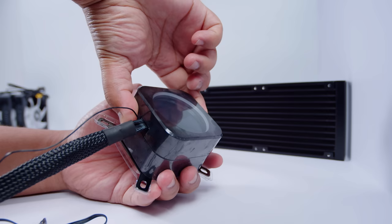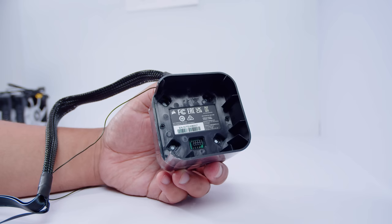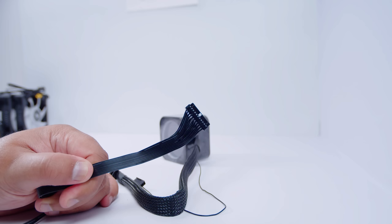At this stage I'd recommend removing the screen. It connects via four magnets — one in each corner — and there's a single connection point to control the screen and send signaling to the pump. On the pump top you'll see four posts where the magnets attach and the pins where the screen plugs in. There are also a bunch of cables coming off the screen — a ribbon cable for controlling basically everything and a USB cable for iCUE control.